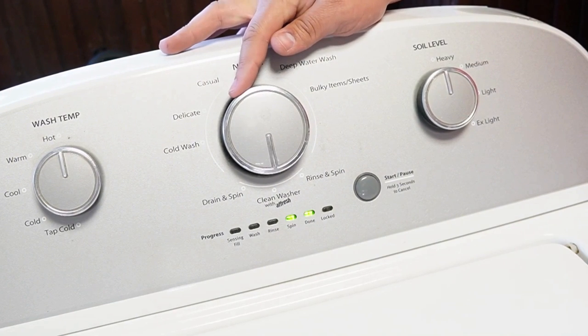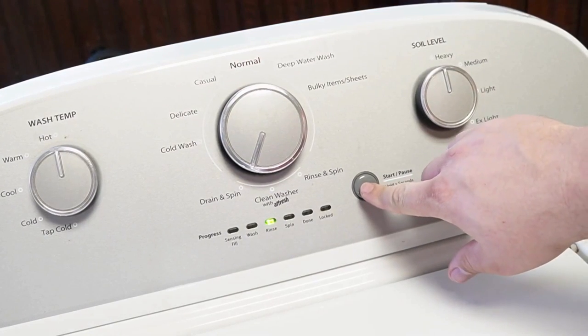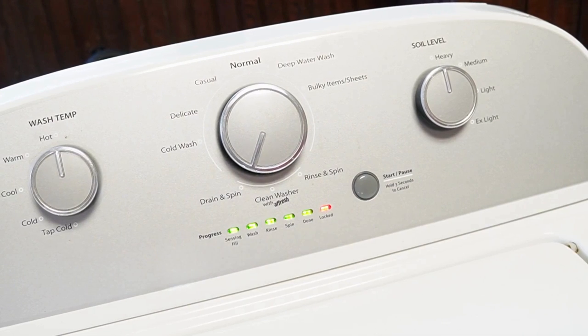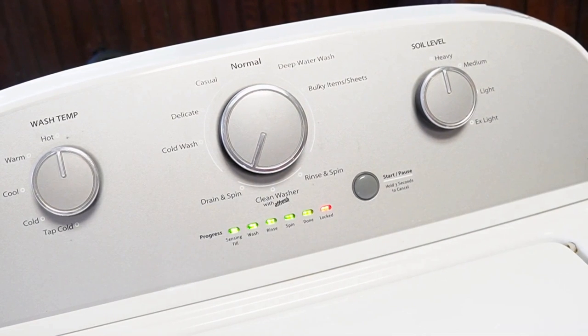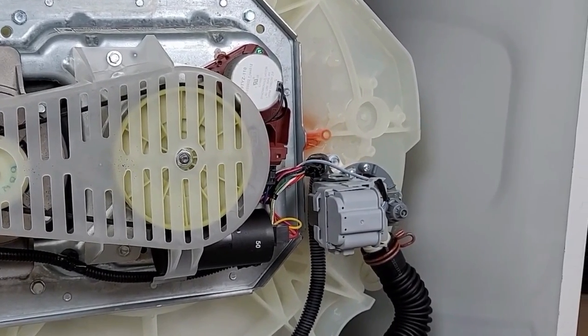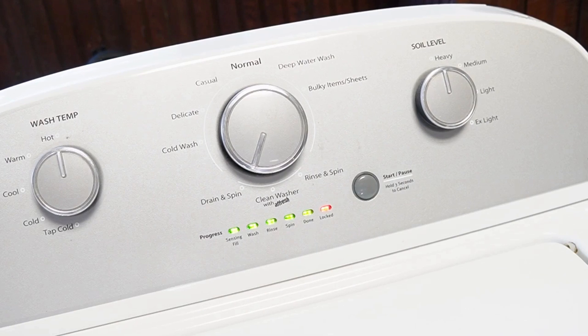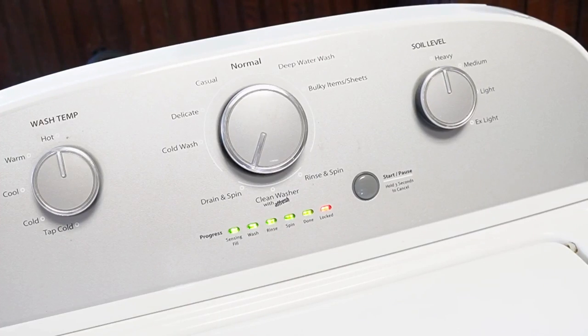Once you're in this mode, turn the knob clockwise four times. The rinse light should be the only one illuminated solidly by itself — this is the recalibration mode. Once you press the start button on the rinse mode, the door lid will lock and it will begin a series of tests and operations on your washing machine. All these tests take approximately three minutes to run all the way through. As the recalibration mode runs, every part and process on this washing machine is going to be run and the machine will physically reset all the components to a default state, allowing them to run at an optimal level. During this time you're going to hear all kinds of noises from the machine, and that's going to be totally normal.